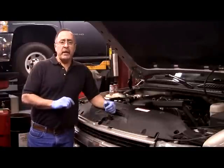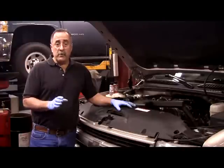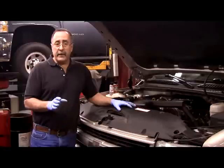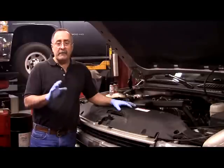You may need to perform an idle speed relearn, especially on a drive-by-wire vehicle such as this one. Follow the appropriate shop manual for more information. Some vehicles by design are not easy to clean due to limited access to the throttle body. Regular fuel system maintenance steps in the other areas discussed today can help throttle body life as a result.